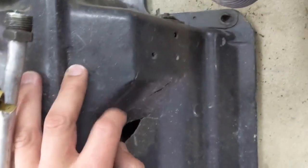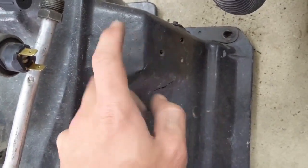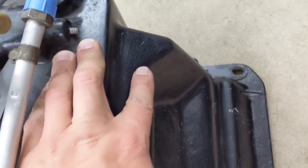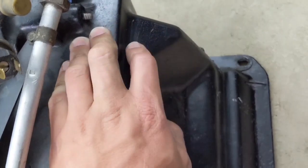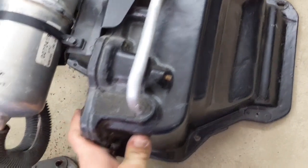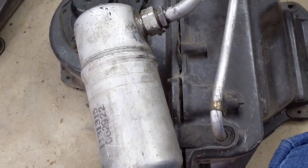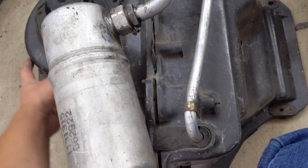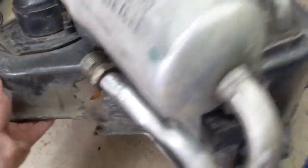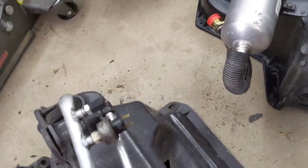I finally got that box out of the car. You can see this is the old junker one and here's the new one. On the old one, this big section right here hits your coil pack. On the new one, if you do it yourself, you have to shave that — basically cut it in half, make a triangle out of it, flatten it as much as you can through here, re-glass it back in and you're good to go. Now, I couldn't figure out why this car didn't have heat for the longest time, and we finally figured it out when I got this box out — that thing is cracked in half. Not good. It's junk.